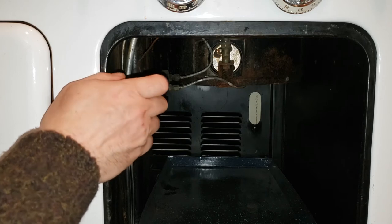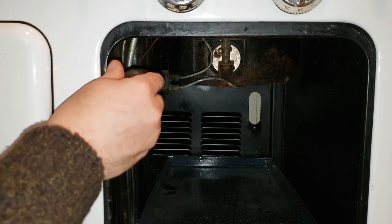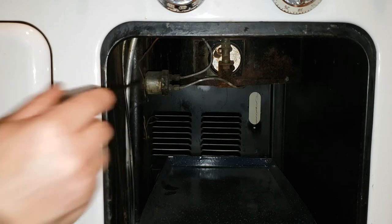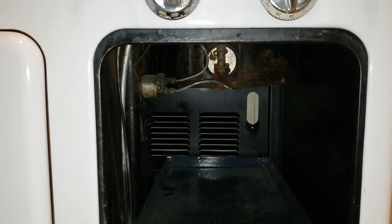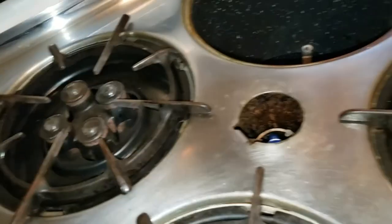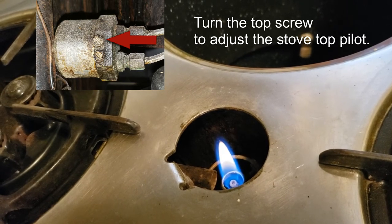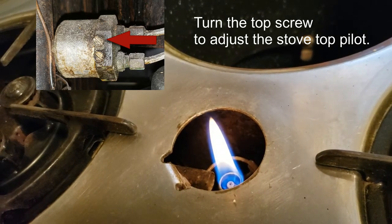All you have to do is gently turn these screws one way or the other — turn it to the left in order to raise the flame, turn it to the right in order to lower the flame. Turning down here affects what goes on up here. This is turning that screw a little bit to the left. Now your screws may be kind of tight — they should be; these aren't the kind of things you want to have be loose. That's obviously way too high and you can keep going.